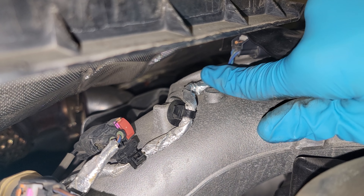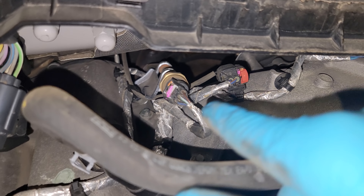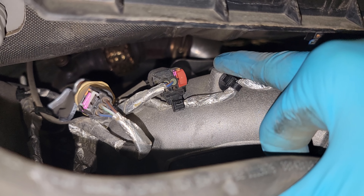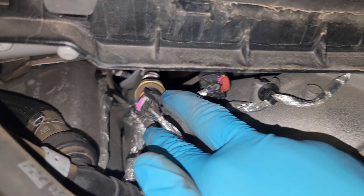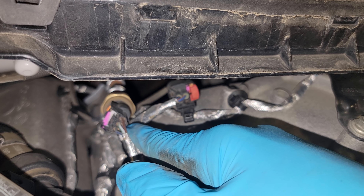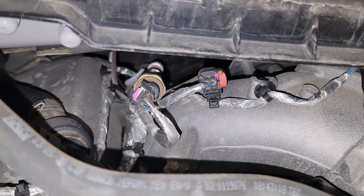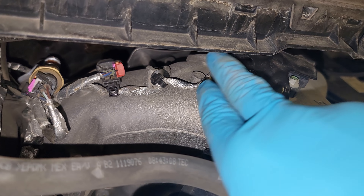Paying attention to your EBP and your MAP sensor — right there, focus — three wires right there. These are interchangeable: you can plug the MAP into the EBP and the EBP into the MAP. If you notice on this part of the harness, you have a tether, a zip tie with a Christmas tree clip in it, that tethers right to this spot on the upper intake manifold. The EBP sensor wiring does not have that tether. Although these do plug in and they do read pressures, this one is supposed to be reading atmospheric. Atmospheric is 14.7 PSI — that is what's pressing down on all of us right now. We currently have 14.7 PSI pressing down on us, and that is our zero baseline.